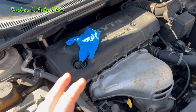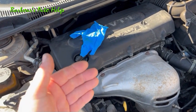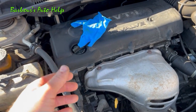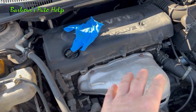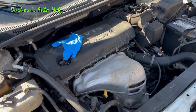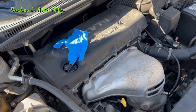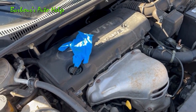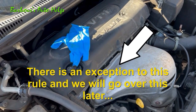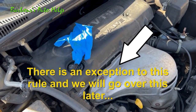What are we talking about when we use the word bank? The best way I could describe a bank is a row of cylinders that share a common cylinder head. On this 4-cylinder right here, it has one bank — one row of cylinders with one common cylinder head, sharing a common intake and a common exhaust. The same can be said for most inline engines — inline three cylinders, inline four cylinders, inline six cylinders. If you have a row of cylinders that shares a common head and only one row in the engine, it's going to be one bank, and that bank is going to be called bank number one.